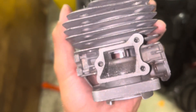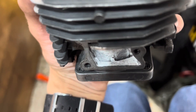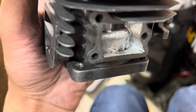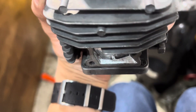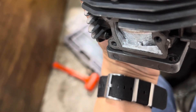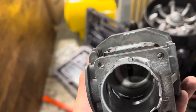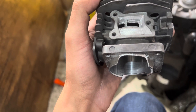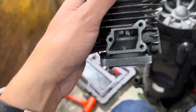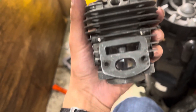So I'll clean that up and widen it. I don't think I'm gonna raise any of the upper transfers. As you can see, there's that little nub that was sticking out — I cleaned that up, went all the way through, slimmed that divider up, and just kind of went to a point. On the left side I widened it all the way to the wall. I opened it up on the left, raised the skirting — you can see on the stock side it just goes about a quarter inch — so the transfer should flow a little better. I'll widen the intake a bit, and the exhaust is pretty big.